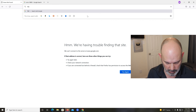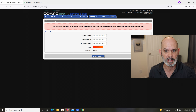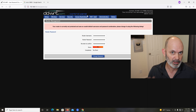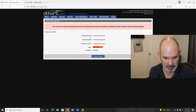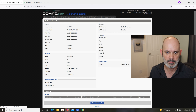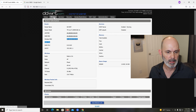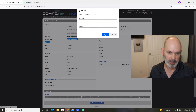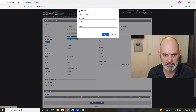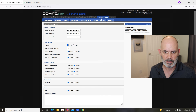This is the welcome screen for DD-WRT, and as far as I'm concerned it should be the welcome screen for every router — it asks you to change the username and password right away. Put in whatever username and password you want and hit Change. Now we're into the router and you can see it looks totally different and it's at a different IP address. Let's go to Administration — it's asking for credentials again — enter the username you set, and I go with 'root' traditionally.